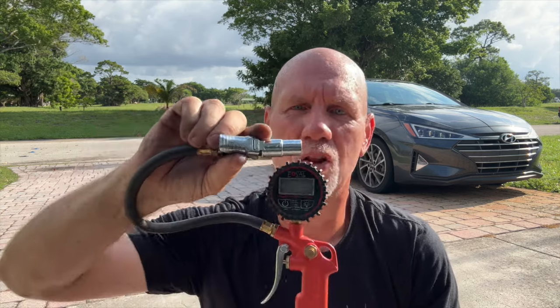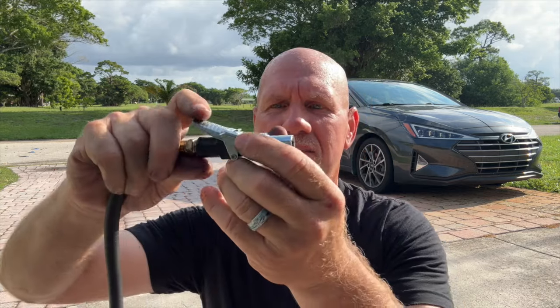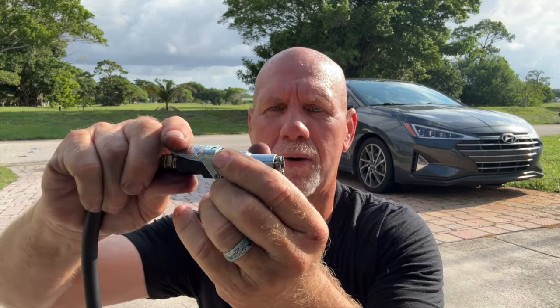I've actually got the Lock Flate. This did not come with the tire inflator, but this is the best attachment that you could possibly get for a tire inflator. We're not sponsored by them or anything like that, but I'll leave a link for it down below. So the way the Lock Flate works is it's got this little lever on here, and when you press on this, it exposes these teeth. These teeth then grab onto your valve stem, and when you let go, it's got a secure connection, and you don't have to sit there and hold it.